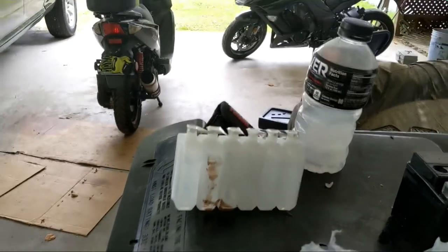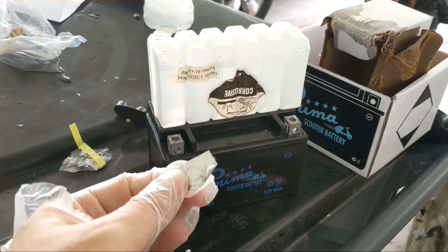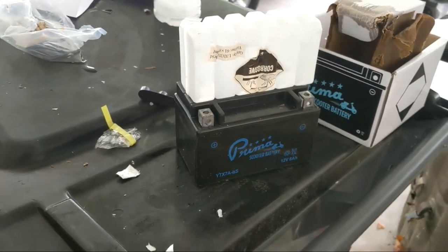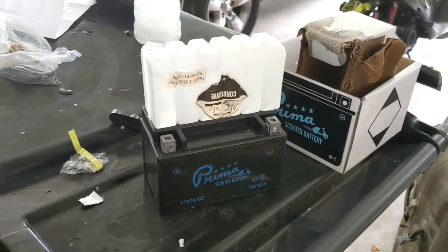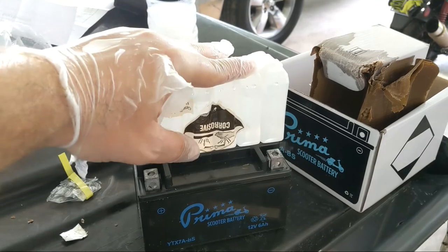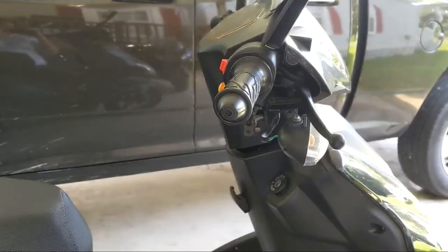All right guys, this thing is super frustrating. That aluminum thing over the top doesn't come off really well at all. I had to use a pair of needle nose pliers to try to get it off, and there was still a film over the top so I actually had to punch a hole in it, which is not recommended. Thus far this is not going so good for me. It's supposed to sit like this for about 20 minutes to let all the acid go into the battery, so I'm going to put it on a flatter surface.